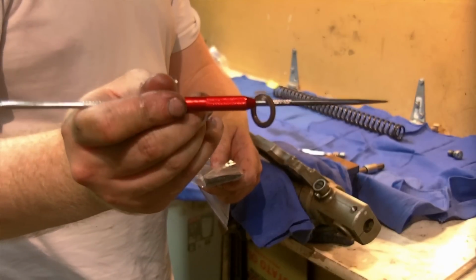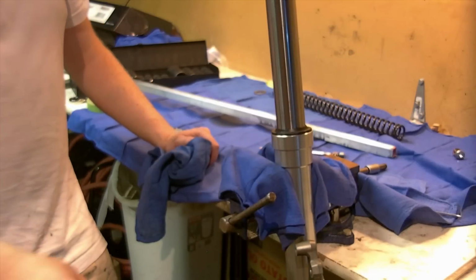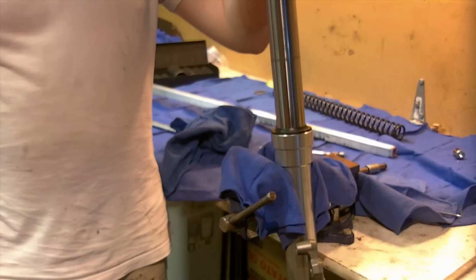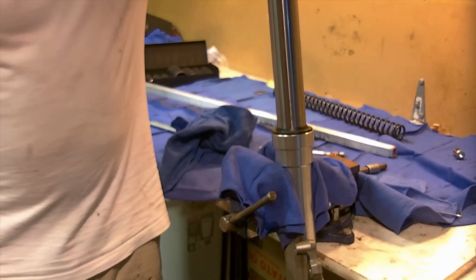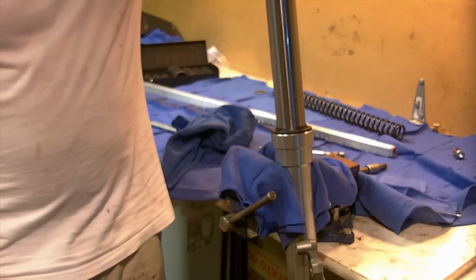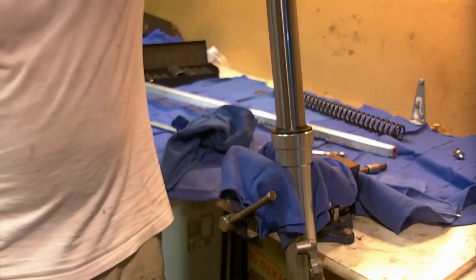There's the copper crush washer that I removed from the lower fork vertical with the pan beneath it. Now that the lower bolt is removed, you can stroke the inner tube up and down a little bit and stroke the damper, and that's going to pump out oil through the bottom right into your pan. There's always going to be some residual oil. Get as much as you can. There's less to go out on your table that you have to clean up later.